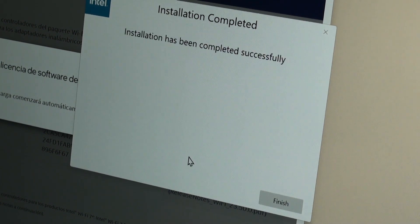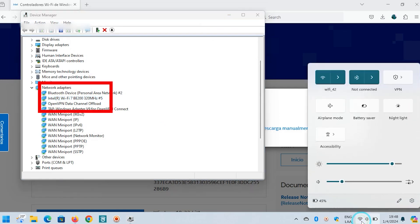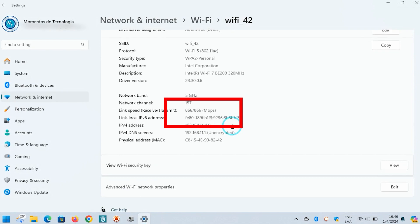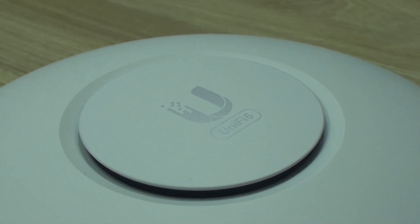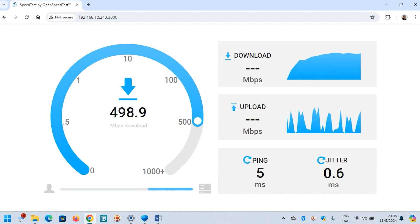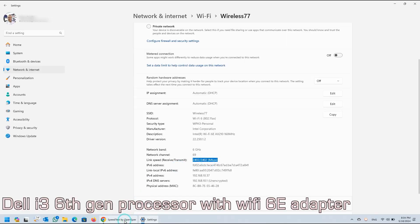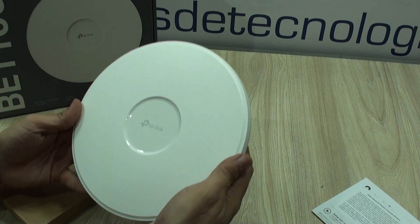I had to go back, correct the mistake, and try again. The way I was able to tell I was wrong is that I had very poor download speeds but very high upload speeds. Once you're done putting it back together, do not completely close your laptop as you may need to temporarily go back to your older card — this has happened to a lot of people. I would recommend previously downloading the drivers for this card, which, as it has an Intel chipset, you can very easily find and have at hand. After having finished this process and Windows having automatically installed the drivers, we started testing. At Wi-Fi 5, we were not actually surprised — link speeds were high but actual throughput was not. We then connected to a UniFi Wi-Fi 6 access point with similar behavior: great link speeds but the same story with an Omada EAP 610, a fantastic access point, where we again got great link speed but not really good transfer speeds.